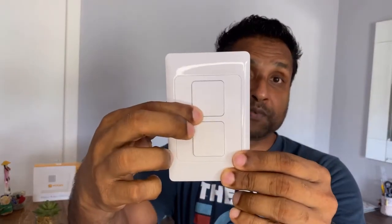Very straightforward — ConBee supports these switches out of the box. Just in case you want to move these switches to another room, it's very simple to reset them as well. One way is using the Phoscon app to go and delete the device from the interface, or you can go to the switch and hold the top switch pressed for 20 seconds, which puts it back into pairing mode. Now let's go and see how we can import this into HomeKit.